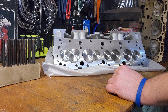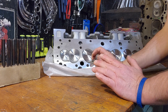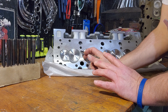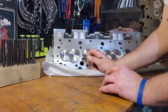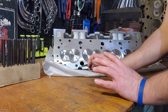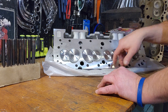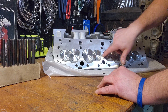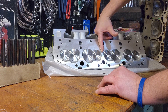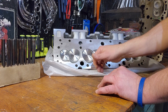What I wanted to talk about with the head in this position: the difference between the cast iron head and the aluminum head is that in the cast iron head there's a water jacket that is nearly a full deck thickness deep between the water jackets — you can see that in the Chevrolet Performance book drawing. On aluminum heads, if you stick your finger in there between the combustion chambers, they're solid almost all the way up to the full thickness of the head. So you have to drill the steam holes at more of an angle so you can actually reach the water jacket.